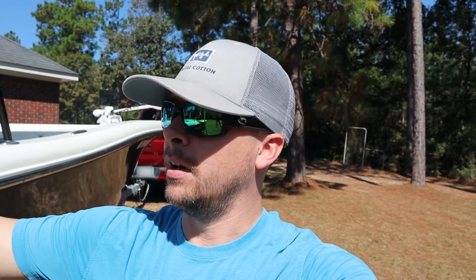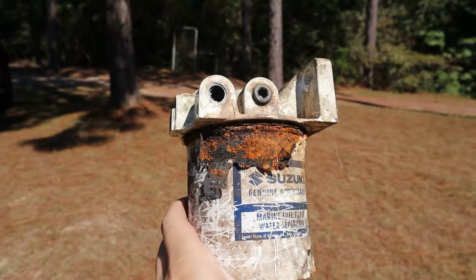What's going on, guys? Today we were going to film another fishing video for y'all, but last time we were on the water, I smelled a little bit of gasoline whenever I opened up the latches in the boat, and we looked around. I didn't see any fuel lines leaking, so I didn't think too much of it. Went and got it yesterday and put some more gas in it, smelled the gas again, opened up my little area where the bilge pump and stuff is, and sure enough, the fuel water separator was actually rusted out and leaking.